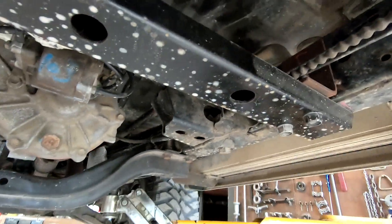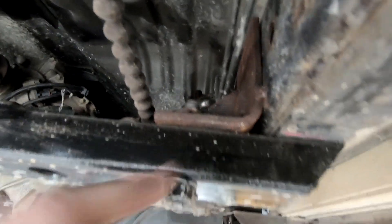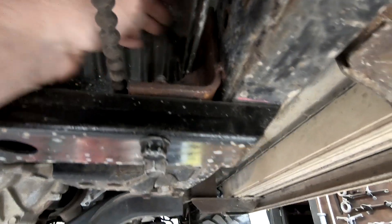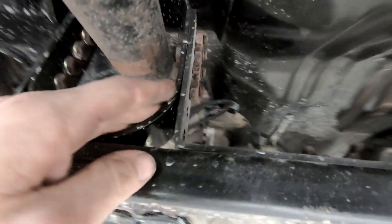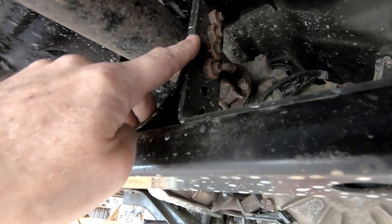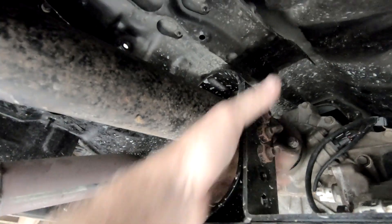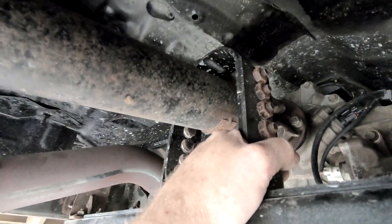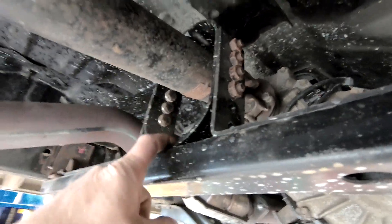So what I do on this one — and yes, these brackets do need to be properly welded in — I put an additional crossmember through most of my four-wheel drives. This plate must be the full width of the chassis, both sides, and then four bolts to hold the hoop to that crossmember. This stuff here is 50 by 5, and that's just a commercially available hoop. They're not ultra sexy or anything, but they get the job done and you don't have problems going to cert with them.